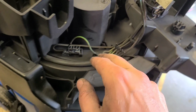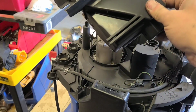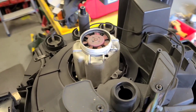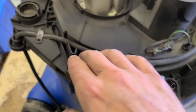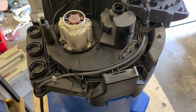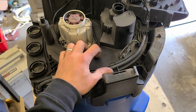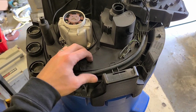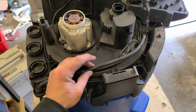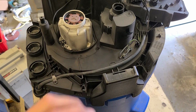And to get better access, to allow you to take this lead out, you can just lift this cover off. That's your whole run for your lead. Now the replacement you want to be like for like. So this here, if you give it a wee clean up here, you'll see is 3-core 1.5mm cable. And this is actually an H05 cable. A little bit light, to be honest.